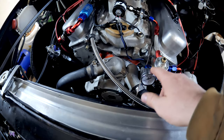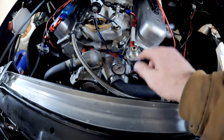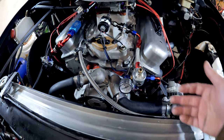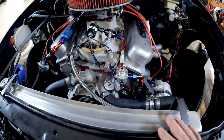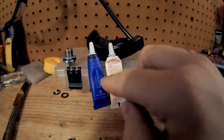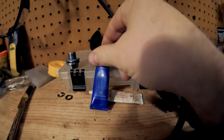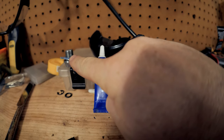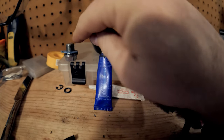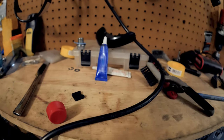Just remember, a lot of these fittings on your vehicle — like this regulator, these plugs — those are all NPT plugs, National Pipe Thread, which a lot of this stuff is designed to use either Teflon paste or tape. But just remember, even if you use the paste or a thread locker so it doesn't leak, don't put it before the first thread on anything that may get clogged in a solenoid, a jet, or your fuel injection. Because if it goes before that, if it dries and flakes off, it's going to make its way into your fuel system and clog something. I know this is probably common knowledge to a lot of you guys, but there's always some people who don't understand why this is happening, and I just wanted to point that out.